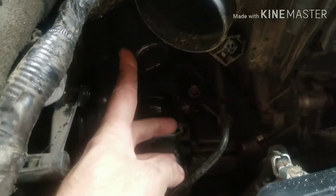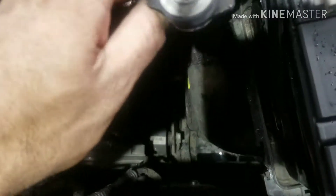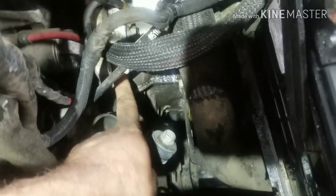It's pretty simple stuff to get this throttle body off. You got this hose, radiator, your air intake boot — you got to take it off and there are like four bolts that hold this throttle plate. It's pretty simple, and I'm going to show you what happened on the dash here.